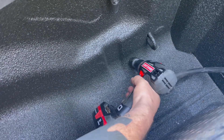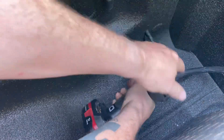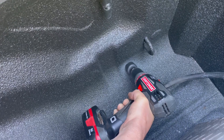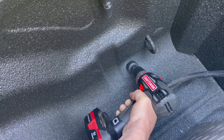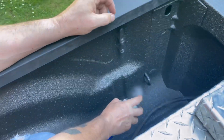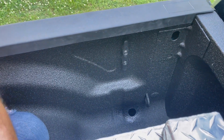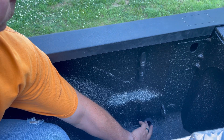Now I've got to put a hole in right here. I'm going to go ahead and get started. Look good? Perfect. There's our hole. We got our hole. We're going to spray this stuff on it, get it in there real good, and I'll go underneath it and spray it too. We put the grommet on so we don't want any of our hoses on that bare metal and risk breaking — next thing you know you've got fuel leaks. I'll use two screws to put it down.